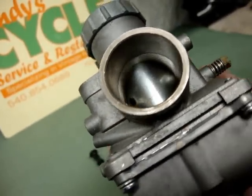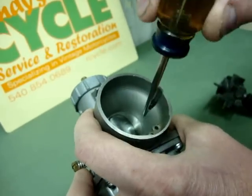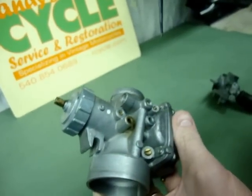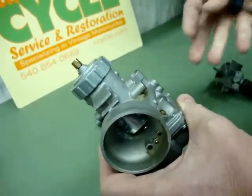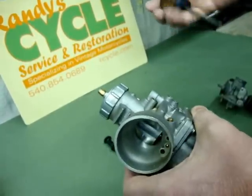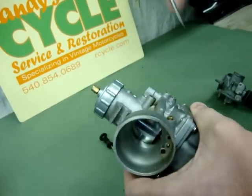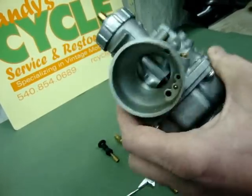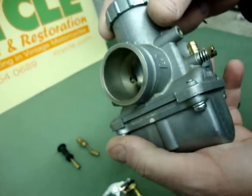In this situation, you're enriching it by adding a lot of fuel through this passage into the intake stream, mixing it with the extra air, which in turn comes into the intake stream. And in this situation, we actually end up with a fast idle. This is the type of bike you can actually start, set the choke lever, walk away from it, let it sit there and idle by itself while it's cold until it warms up while you're putting your gloves and helmet on. With the type we demonstrated with the old Amal, you cannot do that because there is no provision for a fast idle. So that is how this system works versus an older system — a better improvement, just a little bit different design, still does the same job, but it takes a little bit more of the operator out of the equation.